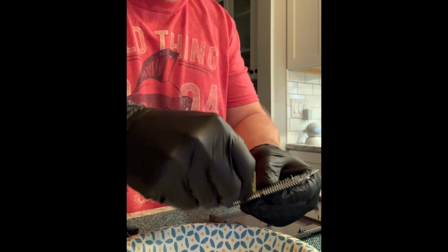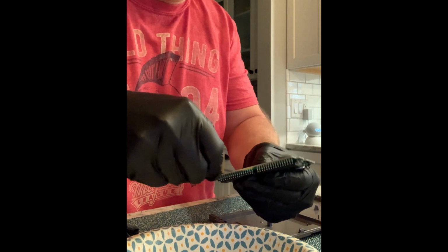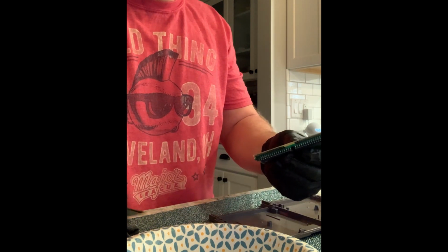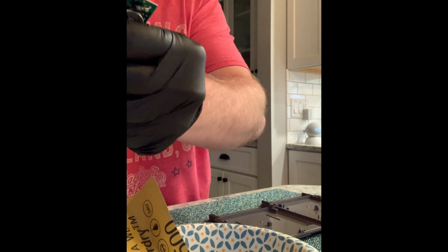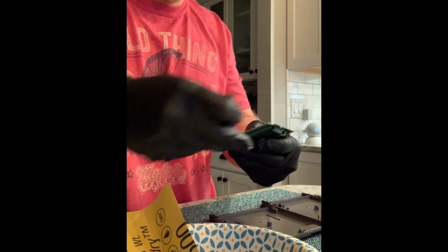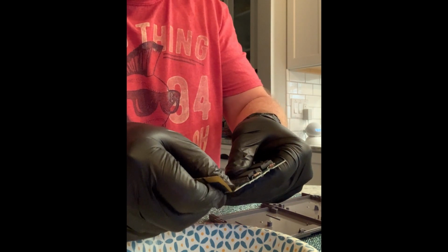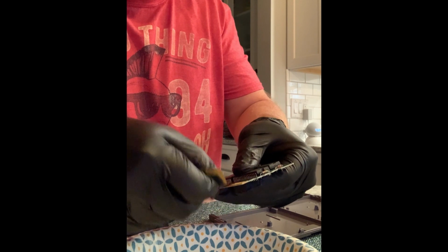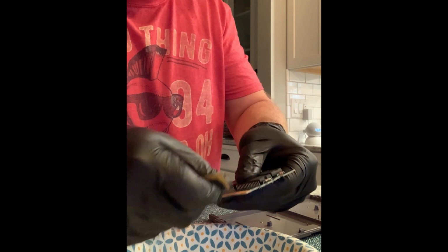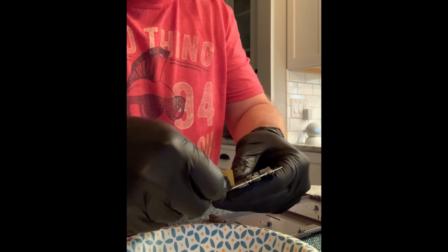Games that I had gotten that white gray screen of death, going back to the 90s or whenever I last picked it up. I did this with another game that I hadn't played in forever, and right off, perfect play. So if you have old NES games and you want to refresh them, this is your ticket. Little acetone, 1500 grit sandpaper. Clean up these connections.